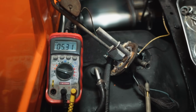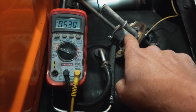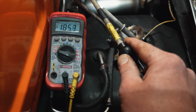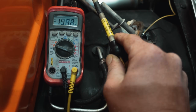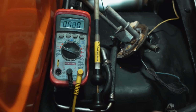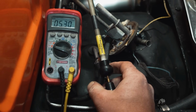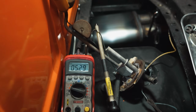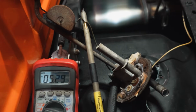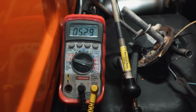Okay, we can do another voltage reading inside to show you that's 5.3 volts. I mean, we could have a problem up here. It is possible that the sending unit housing is an issue. So we'll do another voltage measurement inside. And there's some bare connector there. We can measure it right at that location, or just right there works too. No problem here with poking a hole in a wire here. This is surrounded by fuel all the time anyway, and as you can see, there is a bare terminal already on that. Non-issue here, guys. This is a faulty float for sure.